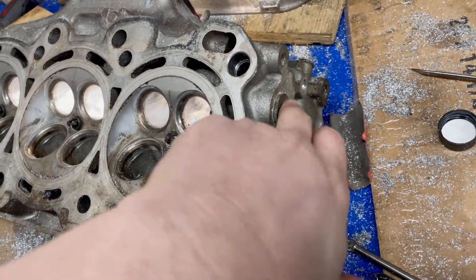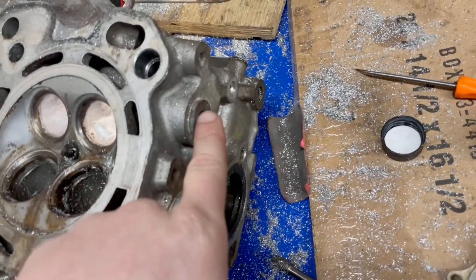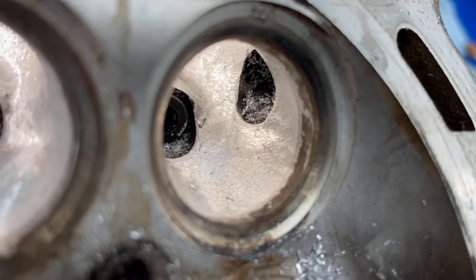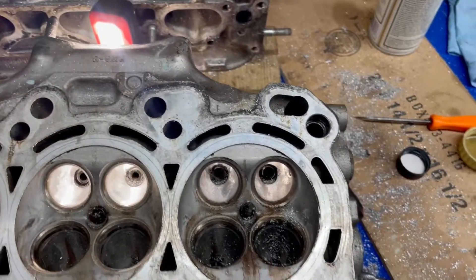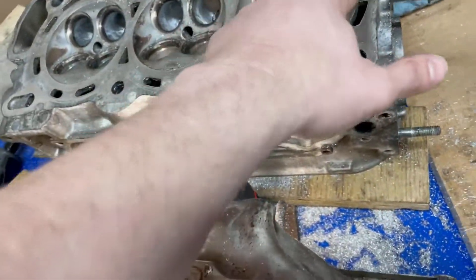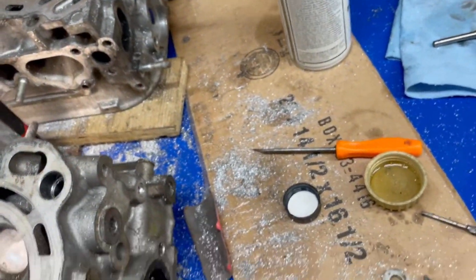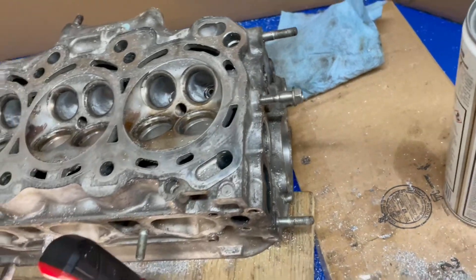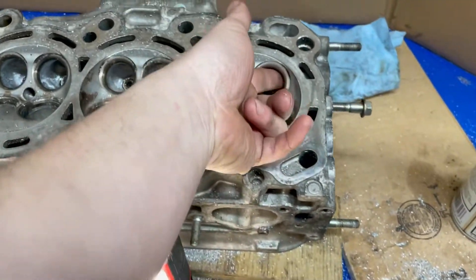I'm going to measure the EGR ports out, then press in - I'll measure on the lathe, get it as tight as I can. If I have to hammer it in or freeze it and expand the head a little bit to push it in, I'll do that. I'll make it small from here so I can put the plug back in, pound it in, and then I want it to be flush. When I grind this down I want this area to be basically smooth like factory - I don't want that slug sliding out. I could even put a little weld on this side. Or I'll take my drill, make a slight quarter-inch bevel here, machine the dowel piece a little bigger so it slides in and can only go one way, then grind it smooth and blend the port in.